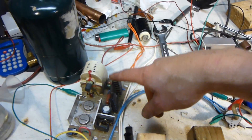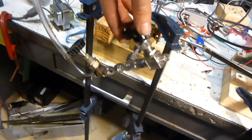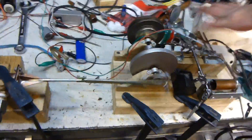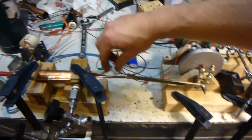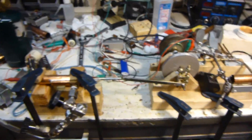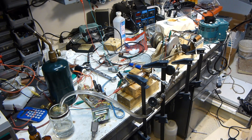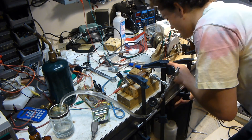Right here is an ozone generator — actually it's from an electronic air filter from a furnace, and I just have that hooked up. It seems to be working. Oh, it's so close. I think just my fuel-air mixture is not quite right, maybe that's all I can figure. But it is trying so hard. I'm actually going to move the stroke in a little bit — I'm going to move the flywheel over that way, like a quarter inch, maybe less than that. Let's try that and see if it gets a little bit more compression, because I moved it away so it wouldn't get as much compression. I think I want to move it over just a little hair and see if that works. I set up the camera and I'm looking in the camera — I can't even tell what is the engine, there's so much stuff on my workbench here.